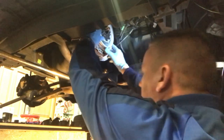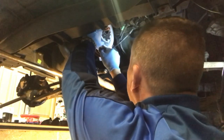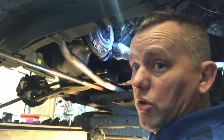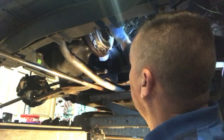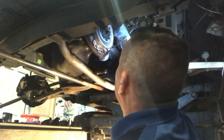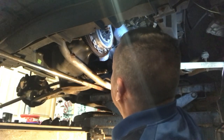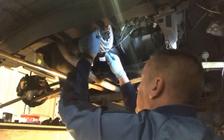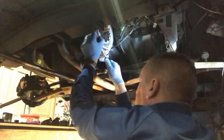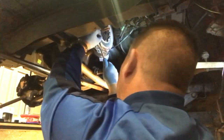Like that. And then we'll get these little 12mm bolts, and we're just going to put these in and do them up in succession. So when we're doing these up, we're going to do them on opposites. So we just nip this side, that side, that side, that side, and just keep working round to avoid any clutch judder. We just make sure we've got these all in nicely, all evenly bolted. And again, you'll see the fingers closing up as we wind these in, and it squeezes the spring up. So these are all down to the base, and we just whack them up. Not mega tight, I'm going to go over the top.